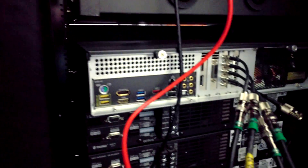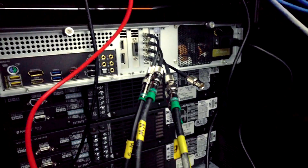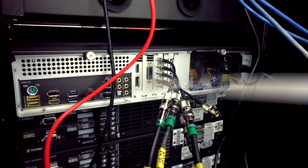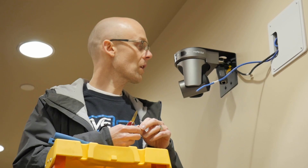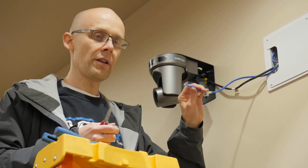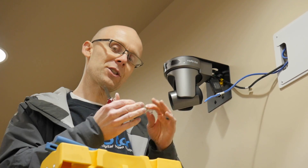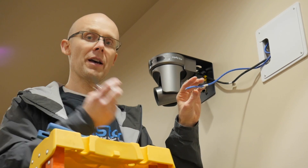When that's done, I need to get my control surface, keyboard, and monitors all plugged in. Then we can power up and make sure we have camera signals, and then work on getting our network control configured. We've been working on getting these four PTZ Optics cameras connected for network control, with our RG-6 SDI cables all connected as well. I was having trouble getting network access to one camera and realized the two RJ45 connectors were pinned out differently — that's why communication wasn't happening. So I'm going to re-terminate this cable for proper network connection.